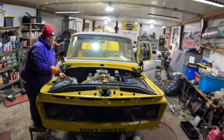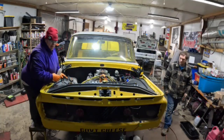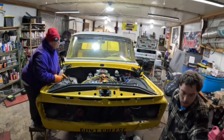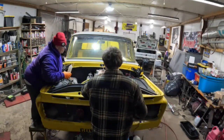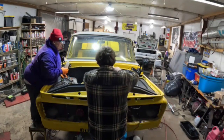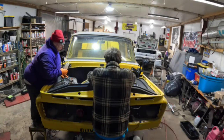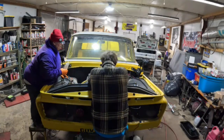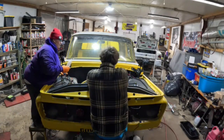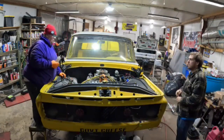Still no fuel gauge. I ain't worried about that until we get it to run. Get that long screwdriver, Kyle. Should be this one right here. We're gonna have to turn the idle down just a little bit. Turn it backwards about a half a screw. That should be toward you, right? Yep. Right there. She's cold-blooded because it ain't warm.